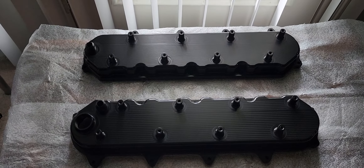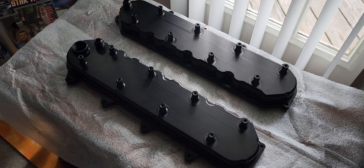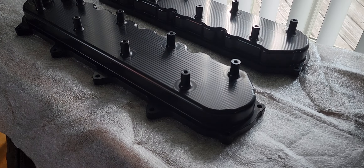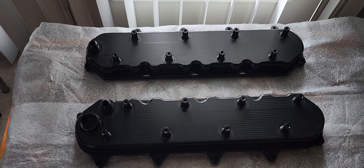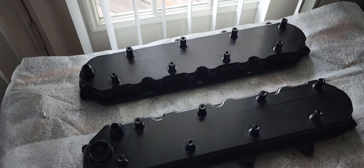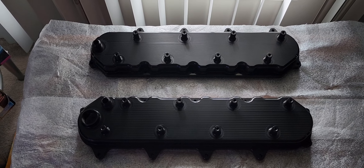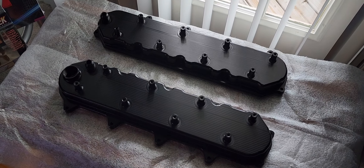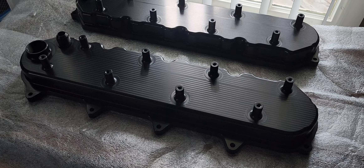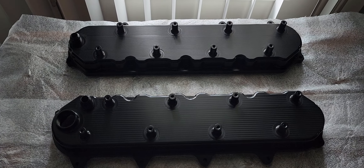I have these to show right now, and while you guys are guessing what these are for — I'm sure some of you know — these are specifically for the Magnuson 2650 supercharger. That's right, I'm going to a bigger blower. I'm going to stay with the 90 millimeter pulley and I'm also going with the Nick Williams 103 millimeter throttle body. I already have a Rotofab intake. I've thought about going to the big intake but I'm not sure yet.